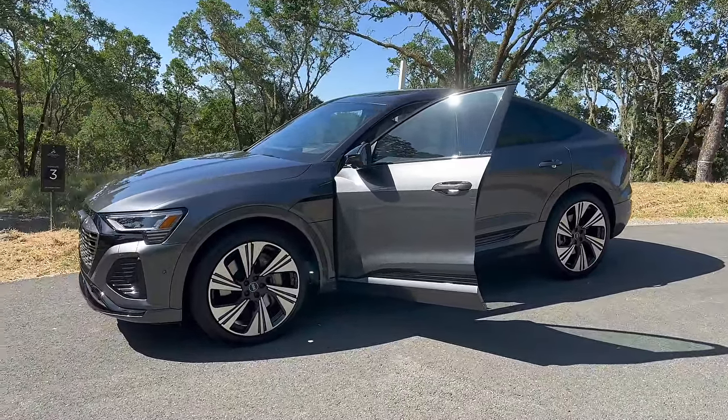The one thing with our e-tron is it really does not like to get moving from a start, and that's partially because it doesn't use a permanent magnet motor. It uses induction motors, which you gotta build up some speed to get the magnetic field to really go and rip. But this definitely has a bit more kick off the line, and it held the boost function longer than ours as well. Now, granted, we are at high state of charge. As you lose state of charge, you get really low, that boost function goes away. So just figuring out some of these differences here.